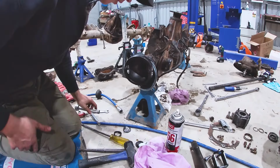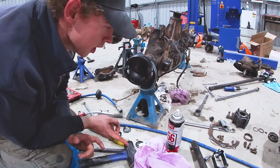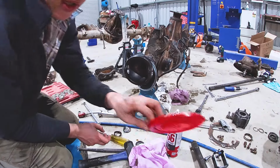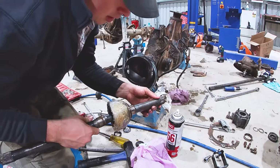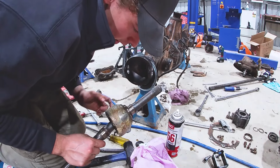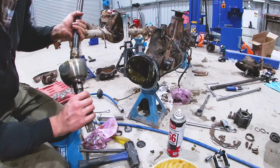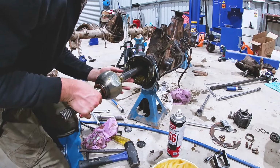And that's in. Now, I'm gonna lubricate the lip on it first before I put the axle in. Little bit of lube on that. Now we've got to clean our axle, and as you can see, it's not great. So we're gonna clean that all up, clean the inside, and shove a heap of grease in here and in here too. Righto, here we go. Nice and greased up.